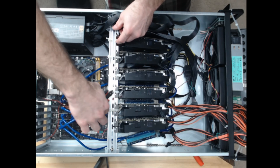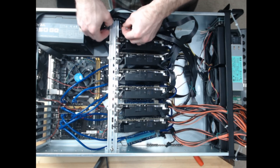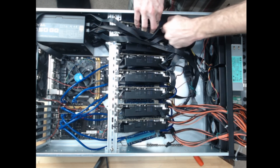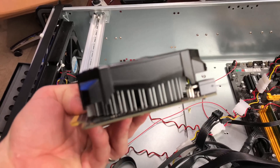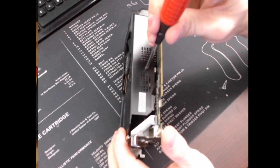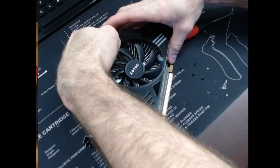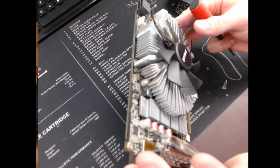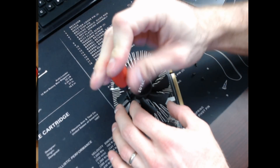With this project, along with all my other projects, I definitely learned a lot. If you remember, during the farm flip process my 1060 rigs — a few of them — were overheating. It's not uncommon for RX 580s or 1080 Tis to really heat up, but the 1060s should be running a little cooler. It almost always seemed like it was the single fan Zotac mini 1060 6GB. I've heard people say you should stay away from single fan cards, but during December and January people were trying to get their hands on anything they could — I was no exception. I have a whole bunch of these Zotac mini 1060s.